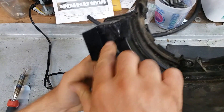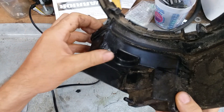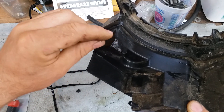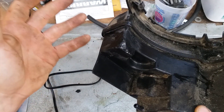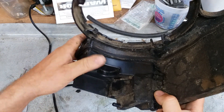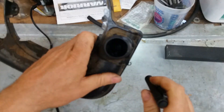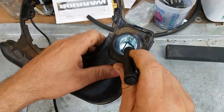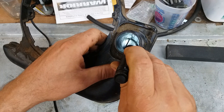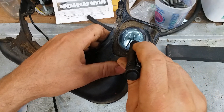Here's the results. It's not pretty, and the more I tried to make it look pretty, the worse it got. I think the key is having a wet rag close and taking the heat out, just like any other welding operation — real welding. If you get it too hot, things just fall apart. I think it's going to hold. It holds up to me blowing through it and doesn't leak. In hindsight, I should have used a stick or my finger — down in the bottom where I was working, it just kind of fell in on itself. That's okay — this is a gas tank for an old worn-out lawnmower. We're not working on a fine Swiss watch here.